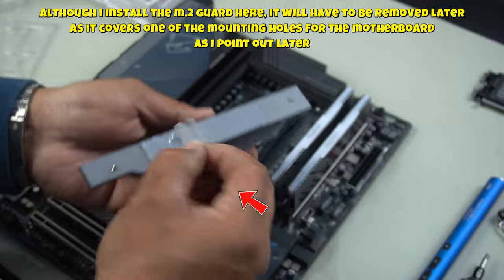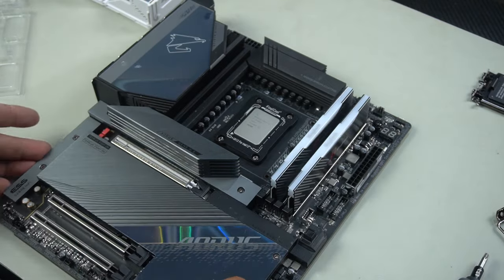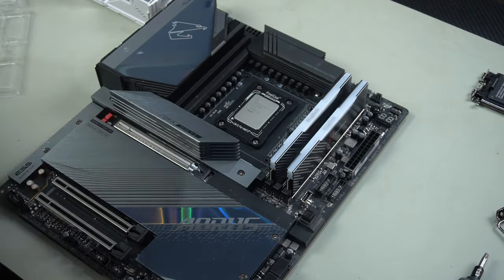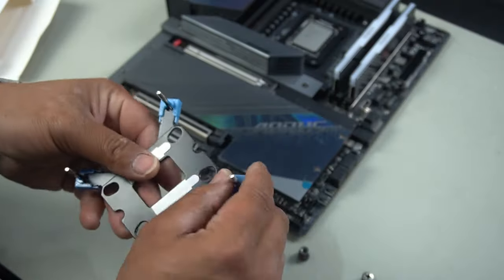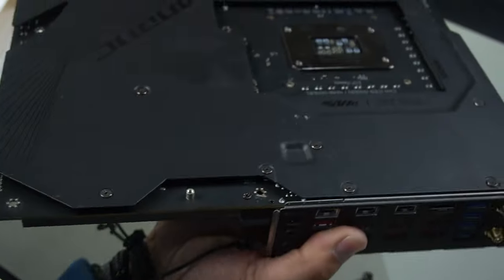Do not forget to peel off your protective sticker. Reline up your screws and screw back down. That's our motherboard pretty much ready to go. But remember we will be using the Thermalright AIO, so we're going to install our backing plate now — that way we don't have to worry about it when it's already in the PC case. Here I've got the toolkit for the 1700 mount, so just ensure that you have it in the furthest position because that's how the 1700 mount goes.